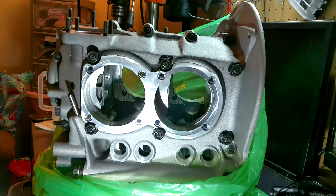With shipping, it's over a thousand dollars. This brand new Rhino case is a little over eleven hundred dollars with the case savers already installed. For that, you get a very thick case that's capable of more than 150 horsepower — which is probably near the limit of the stock case — and it already comes relieved for an 86 millimeter stroke crank and cut for 94 millimeter pistons. That's the biggest advantage, plus it's capable of handling more than 400 horsepower. So we made the decision to go with the new aftermarket case.